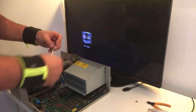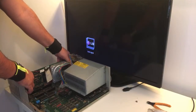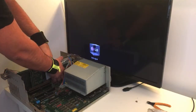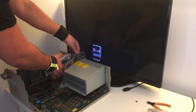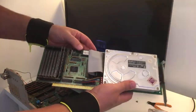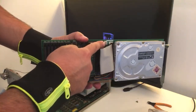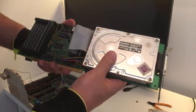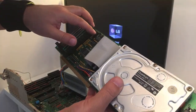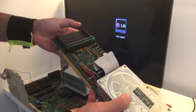It would be great if it just booted up, but it can't be that easy. Okay. So let's just take this one off. Oh, does this require power from the Amiga anywhere? Oh, wait. Is this power over here, guys? Nothing was connected, so I... RAM, the jumper is on J6. And J6 means what, 2 megabyte? I hope so.